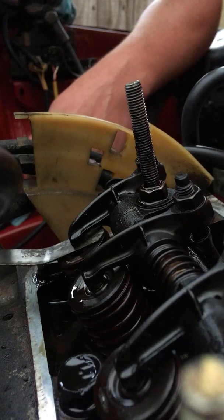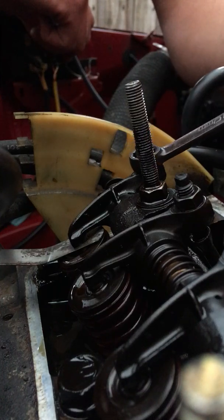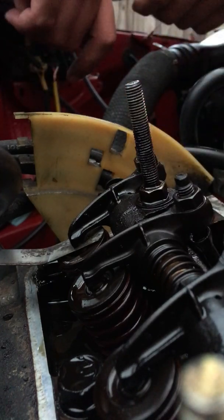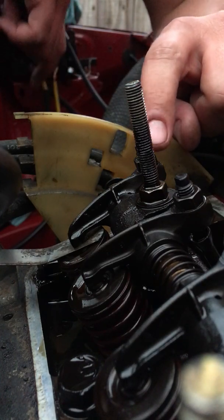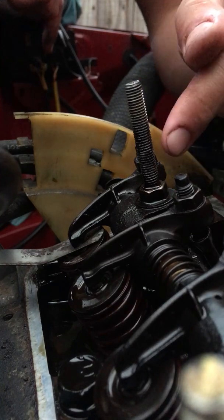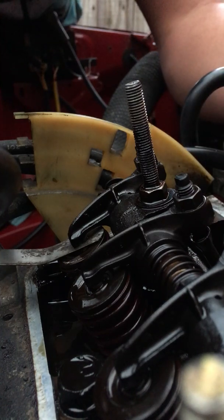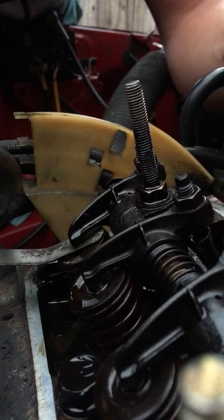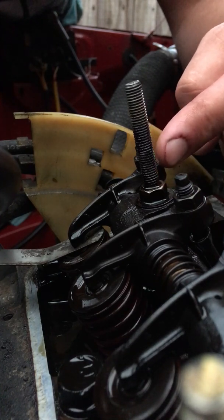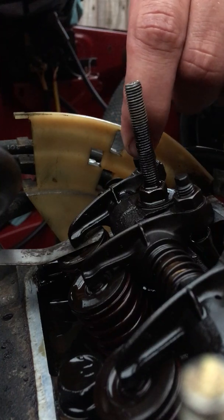When you do need to make an adjustment, you grab whatever spanner it fits — in this case it's 10mm, so it's nice and simple. You place it on there and you're able to undo it, slacken the nut off a little bit. Different motor manufacturers vary: some have a cut in the top so you can put a standard screwdriver in, some have a smaller spanner size like 4mm or 5mm. This one being a Renault, it's quite basic — you can actually just adjust the ball that goes through the rocker shaft, it's on a thread. If you undo that top nut slightly, you're able to, with your fingers, go either way.